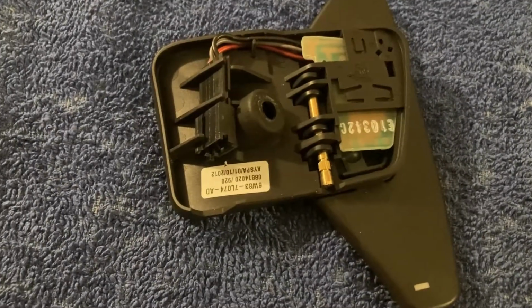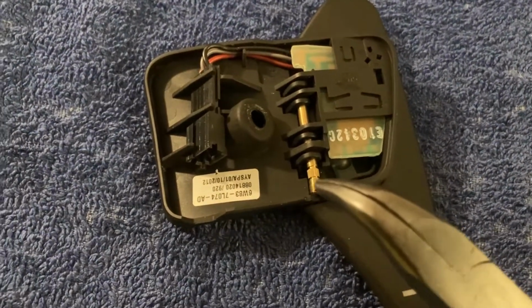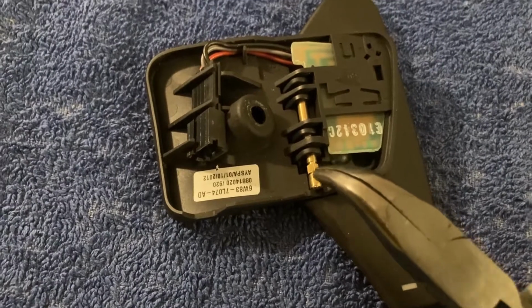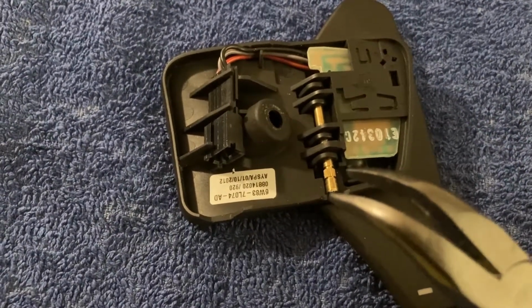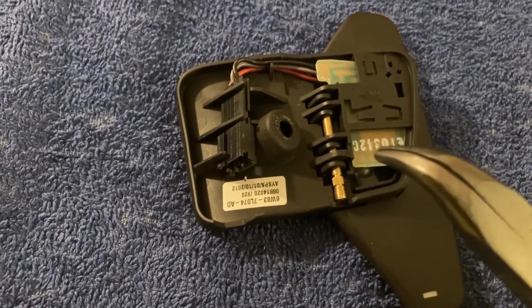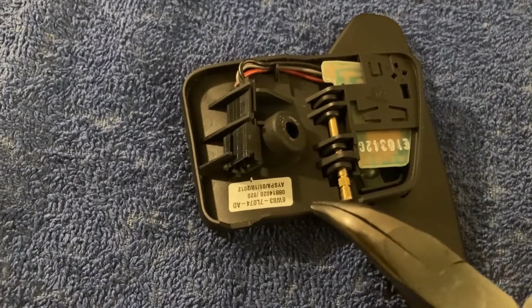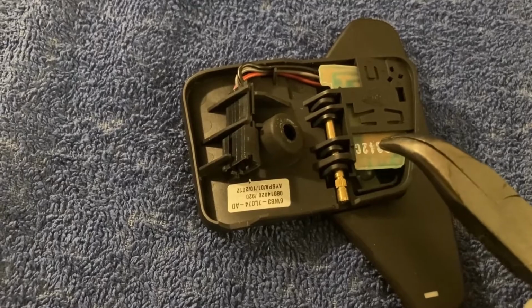And looking at one of the pedal shifters, you see they have this metal pin that needs to be pulled out. I'm using a pair of pliers to do that. Might take a bit of force, but it comes out eventually. And once the pin is removed, you can split the two plastics, the button itself from the case, and then you can access the PCB.